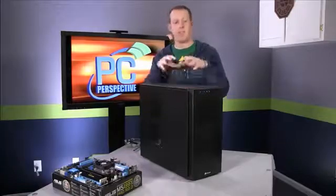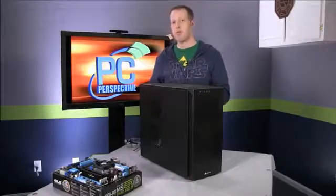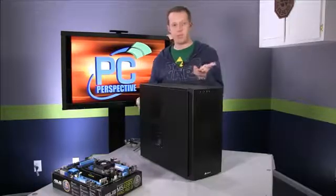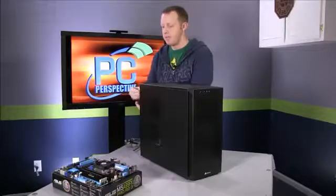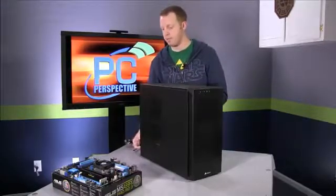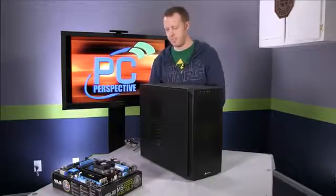All right, so now you've got your motherboard, processor, and memory ready. It's time to bring the case back out, and the first step is to take off both sides of the doors. This Corsair 200R has some thumb screws that are pretty easy to take off. So we'll go ahead and remove all four of these. Make sure you don't lose them. Put them in your pocket, or set them someplace that you won't misplace them or drop them on shag carpet or something like that. Removing both doors just makes the whole build process easier in the long run.